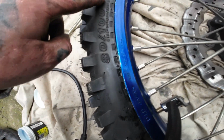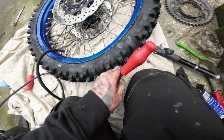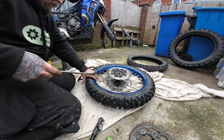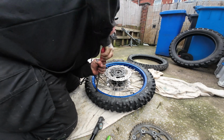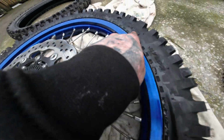Right, so pumping it up, you can see the bead tucks inside the rim there and comes back out again. About 40 psi, so it's starting to creep out on its own, sort of. But if you can, just get your tyre lever in. Just kind of help it out if you like. So tyres on equally all the way around the bead.